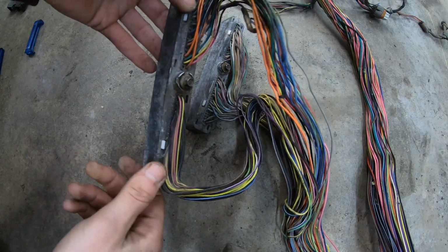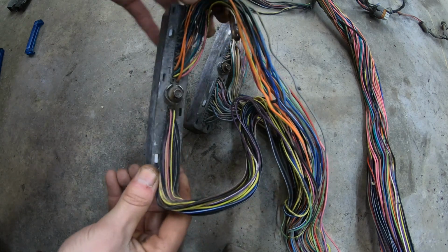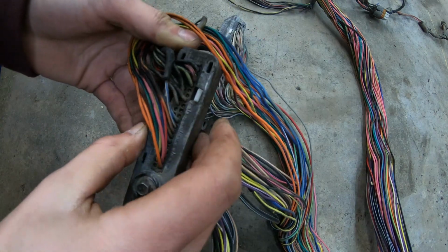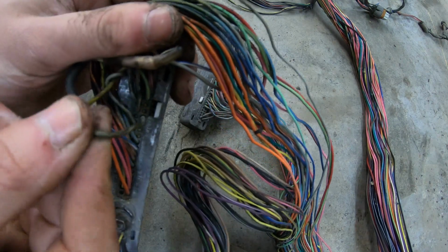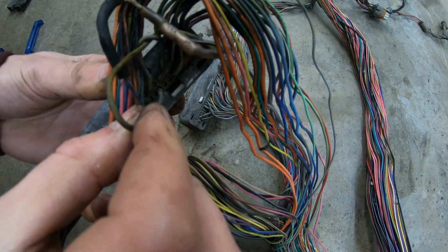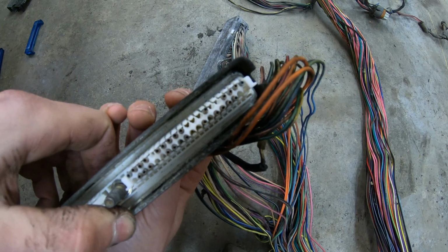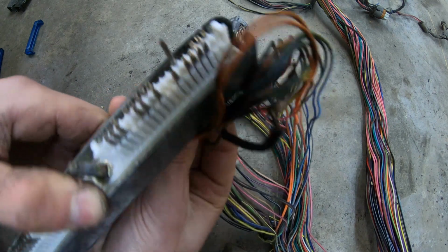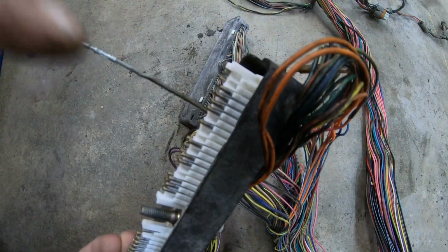The first wire you want to remove on the 2003 to 2007 truck is the pin connector number 7. That is a gray wire. It's highlighted yellow on your sheet. So this is the wire I want to remove. All I do is grab the base of the wire, go on the other end, and just push on the wire, and you see the pin come up. You pull it through, and then you leave it there.